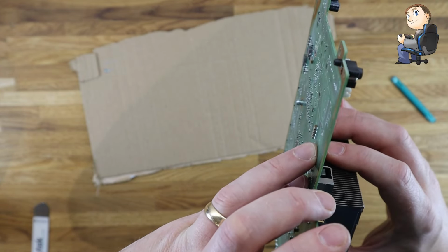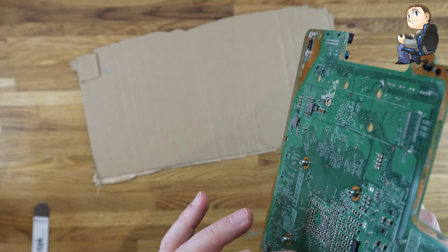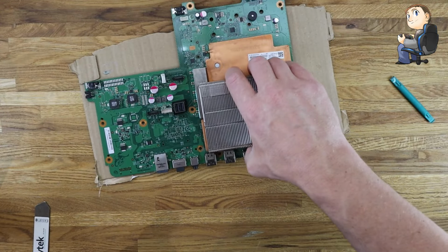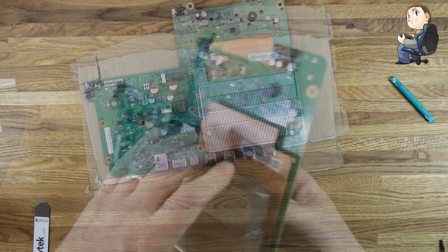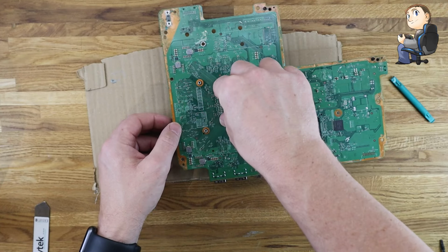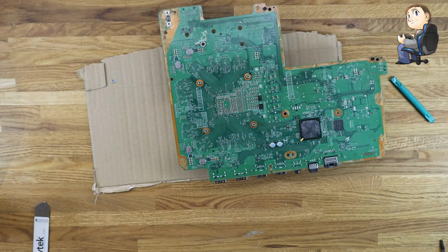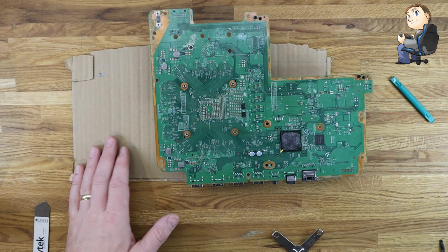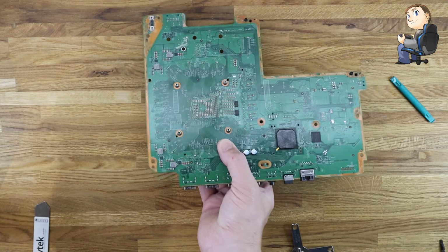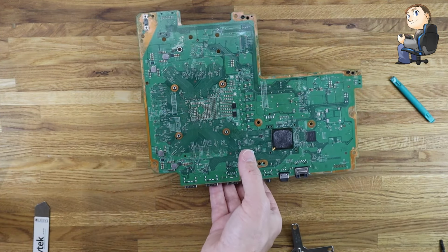Brand new paste. So make sure the pads are on. So I'm going to put it back on. Make sure that the four locating pins go through the back. Make sure all your thermal pads line up and the GPU thermal paste is on. And now we can get the clip on the back of the main motherboard. This is the reverse of what we just went through, so I'm not going to go through that again. Obviously you can just work back.